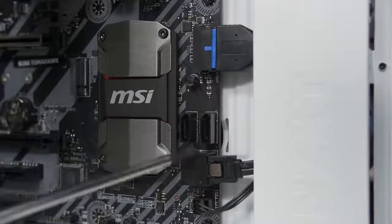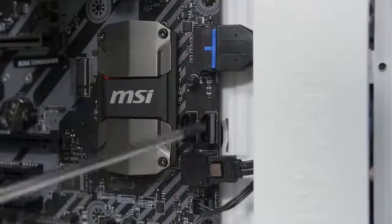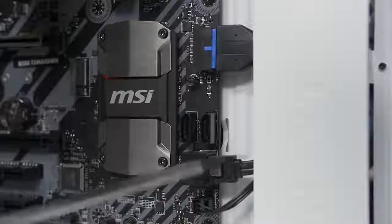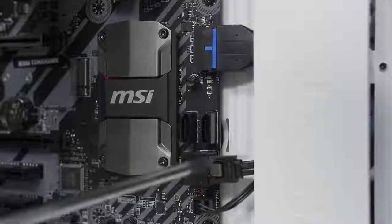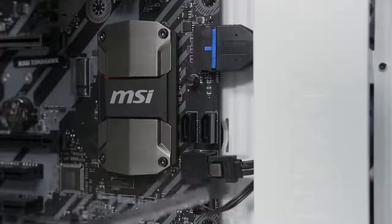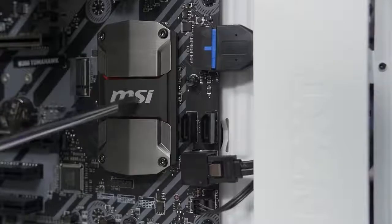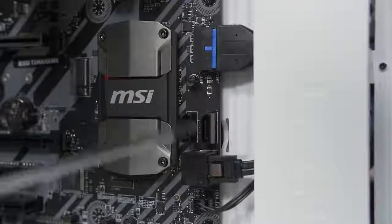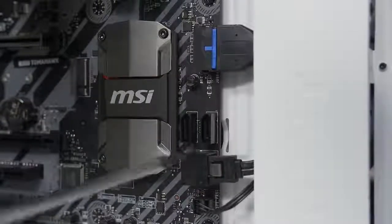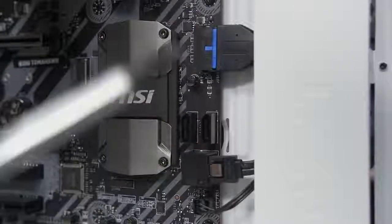In this case, all four of these ports are natively controlled by B350, so it doesn't really matter which ones we go with. But if you were to connect an SSD in particular, you want to be sure it's plugged into ports controlled by the native chipset - otherwise you could incur a bit of a slowdown in certain situations. So just to be safe: native chipset, check the motherboard manual. While we're here, let's stick in another SATA data cable for our SSD that we're about to install.